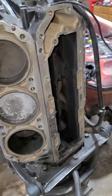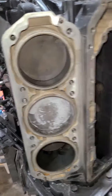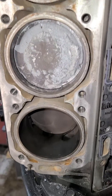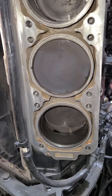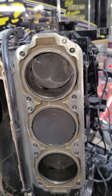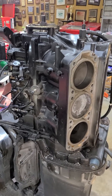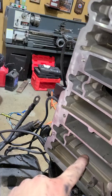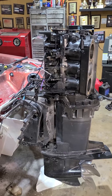Those are the issues we'll tackle. The block seems to be in good shape with no cracks anywhere, so we'll take it the rest of the way apart and measure the bore to see what it's like - whether it needs to be bored out or if we can clean it up with a hone. Got the flywheel off and everything, so next we're going to pull the power head and see what we can do.